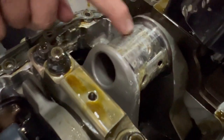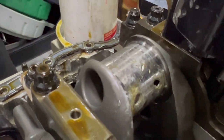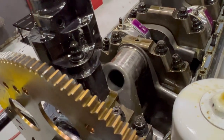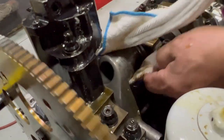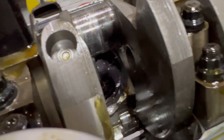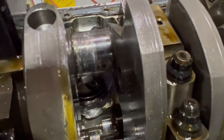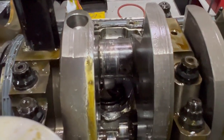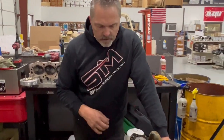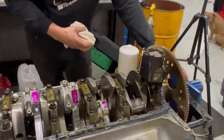Right through here it's definitely destroyed the bearing — it didn't get super hot, which is good. Let's roll it back a little bit more — trying to see the underside of this crankshaft. Here you can see some heat black where it definitely had grabbed and destroyed that bearing. Now once anything destroys a bearing like this, obviously it will destroy the rod very quickly — it'll grab the rod and break it apart when the journal looks like that. So that makes sense.